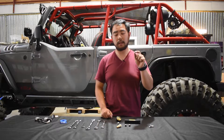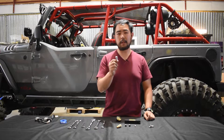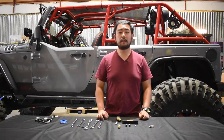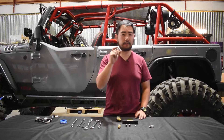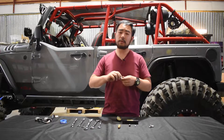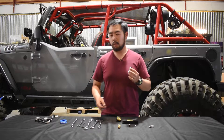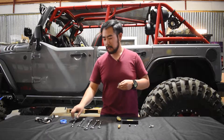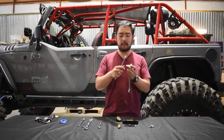Next, you get an 1/8-inch plug and an industrial plug to connect to your air source — either a jetpack or a power tank. First step: we're going to start at our air source. Take your quarter-inch industrial plug and one of your push-in fittings and screw them together. We use global threads on our push-in fittings, which means you do not need thread tape or any type of liquid sealant. We're going to use a 13mm and a 9/16 to get these tight.